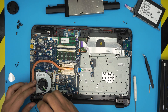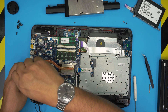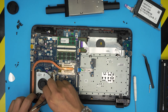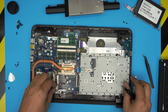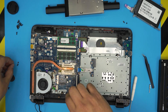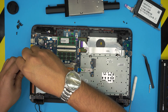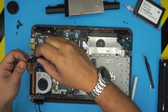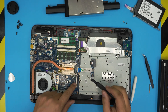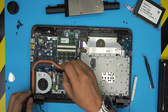Put the two screws for the hinge; otherwise it won't be leveled correctly. Slide the power jack evenly through the contact. Put the screws for the motherboard starting from one corner by the battery and go all around. There should be a battery screw indicated by an arrow.